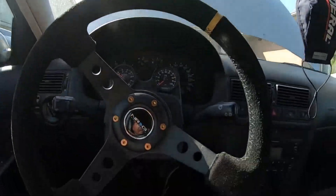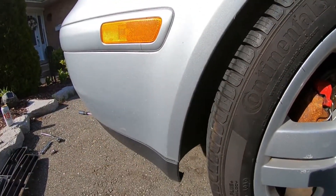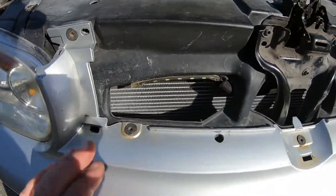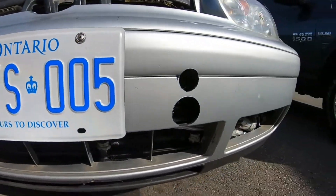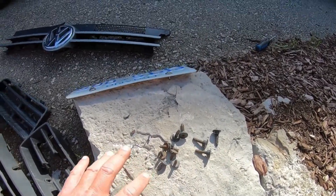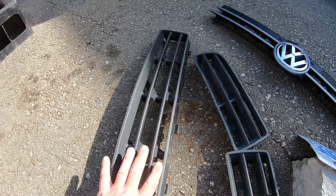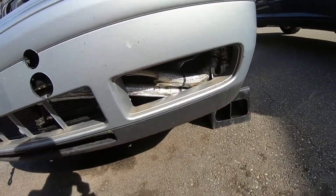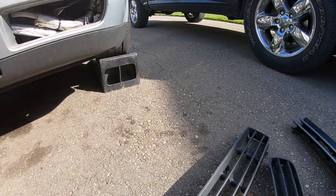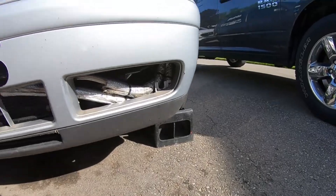It's a beautiful day out, let's go. As you're going around here, remember you've got your T20s on each fender well, then moving across the front the T30s and throughout the bottom of the bumper. I'm going to fast forward through all this - make sure you guys keep everything together. These grills, I actually have a bit of an idea of what I'm going to do to replace them. This is a scrap bumper we bought last year to do all the swiss cheese stuff to it.